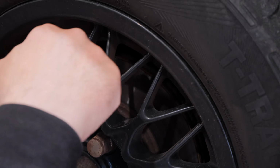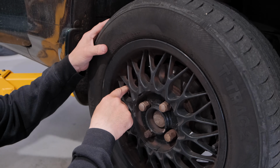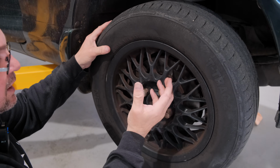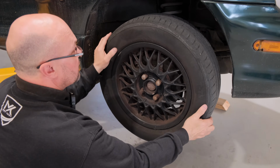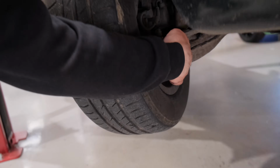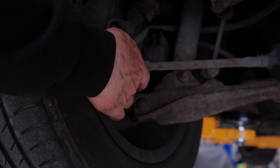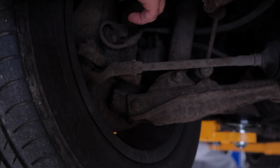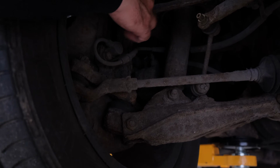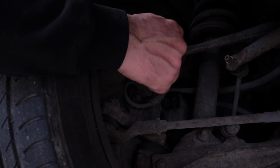And you're going to need the upright from this and the caliper. Again, you can use upgrades on this or put new components if you think they're not serviceable. So don't worry about ball joints and things like that. I would really be changing those out. These bottom ball joints, we do use this bottom ball joint, but if it's not serviceable, which generally I would recommend changing that, and we use a new different style one here. But this part here would be your donor part that you would need to be using.